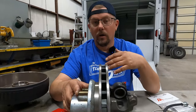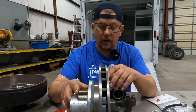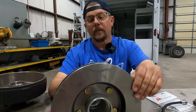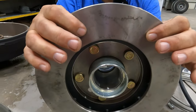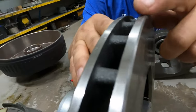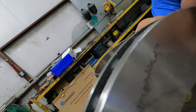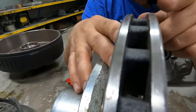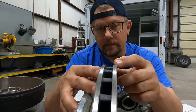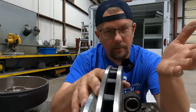You don't want to overheat the caliper and cause seal failure. You can even cause brake fade — basically a boiling or evaporation of the brake fluid — though you usually don't see that unless you're driving a race car. The other thing to look for: see how pretty this rotor surface is? If it gets grooved, ground up, or super rusty, just replace it. Look at that little bevel right where the side meets the top — that's the chamfer. If the surface wears down to where that's gone, the rotor is pretty much worn out and will need to be replaced.